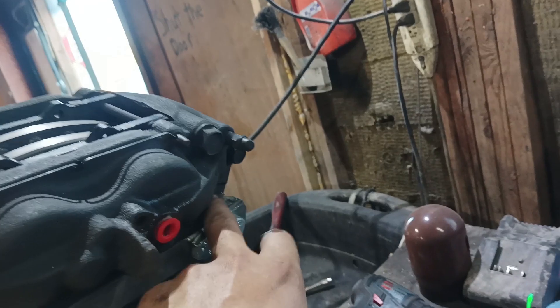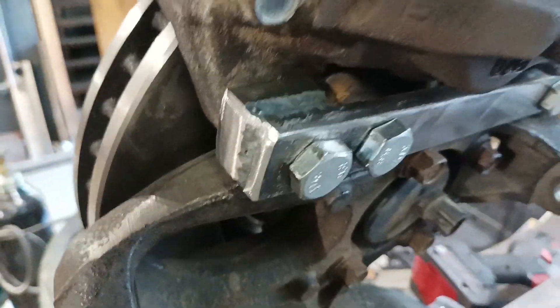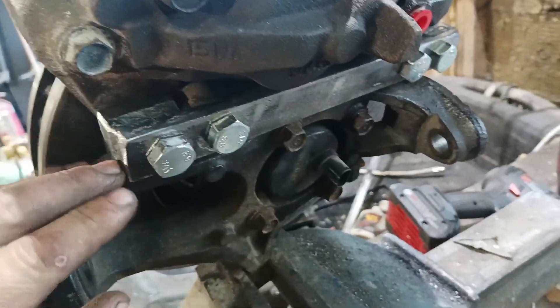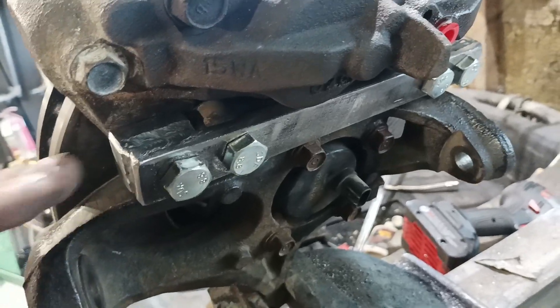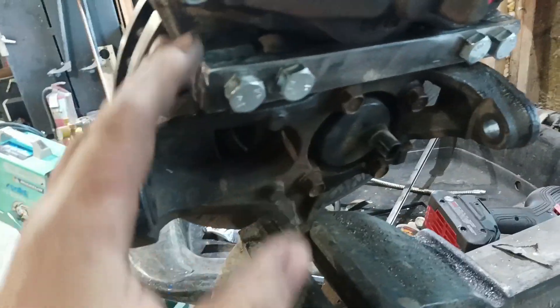Here's pretty much the final product. We welded our bar to our little spacer plates — it's some of the 5/8ths stock I'd bought. I actually bought this for the brake caliper adapters for the S12 to run the Freestar, but I ended up using aluminum because I needed a half-inch — just some off-cuts. It's in there. It lines up — we're both on the wedge here and that. Same on this side, and they also wedge up into the knuckle itself.